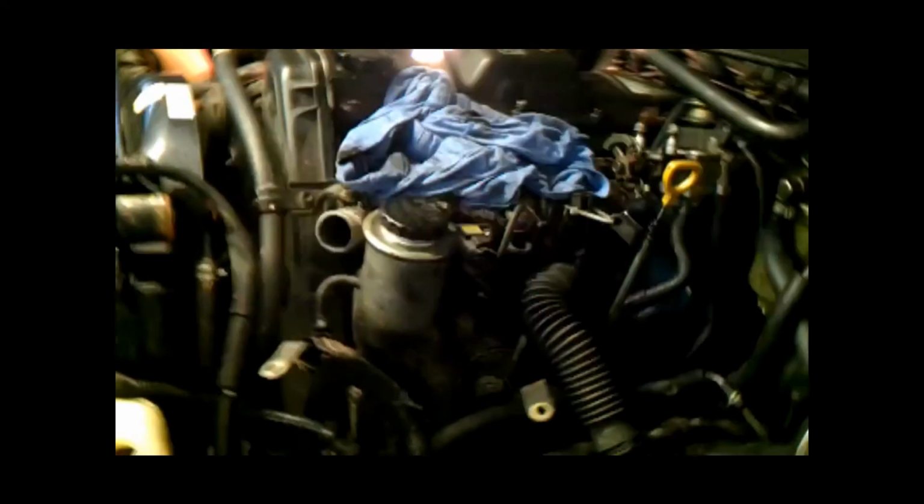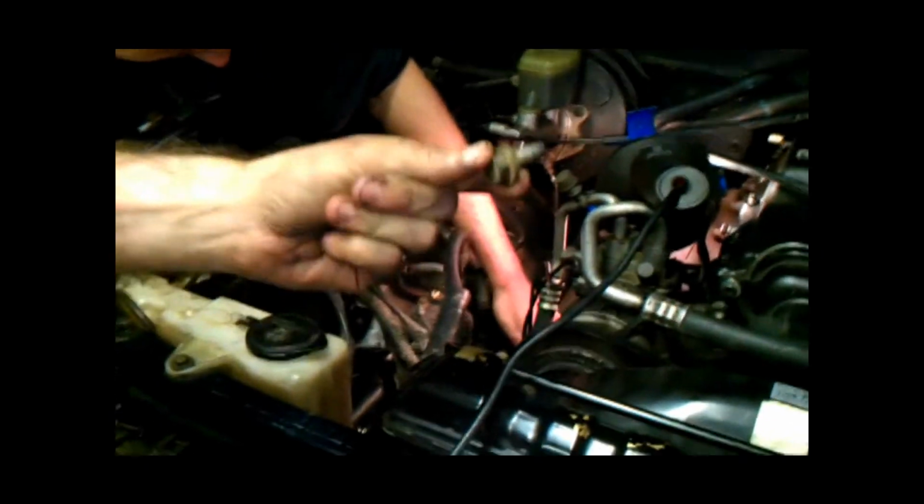Right. We have two engine mounts in, and most of the original bolts. The last bolt, the rear one on this side, is actually a 13mm, not a 14mm. And there's the two knackered engine mounts. We put the 13mm in temporarily because we couldn't get the 14mm in. Having lost it, we tried a replacement bolt that turned out to be too big, and when we found the original bolt, it was sitting on top of the diff. There is the original bolt.